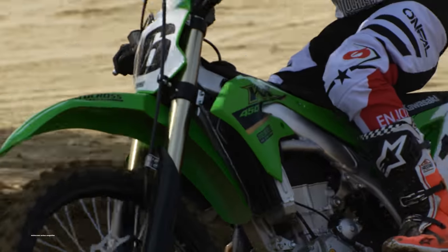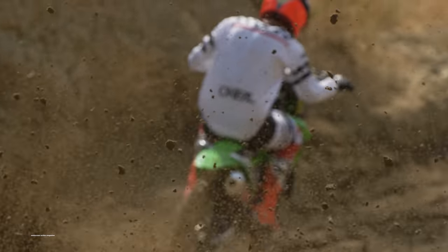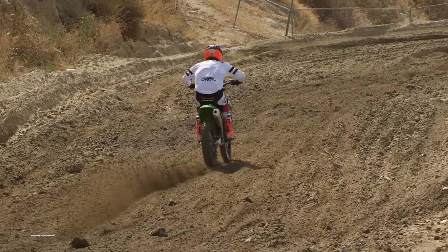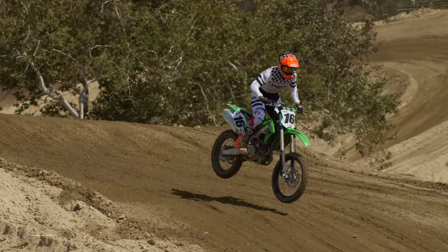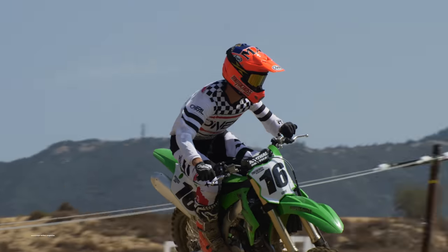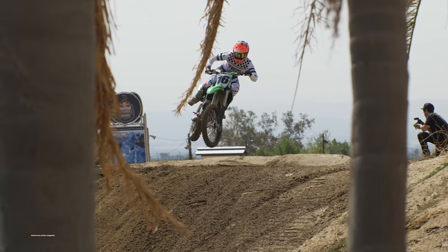The white one, it should be noted that we've tested this coupler on the dyno. It doesn't make the bike any faster. It just makes it pick up even more snappy coming out of corners and just kind of wakes up the power band. So white coupler, the aggressive one, you're not gonna get a lot more power or really any more power, but you will feel a little more snap, which is kind of interesting and hard to think about when the green one is already so snappy on the stock bike.